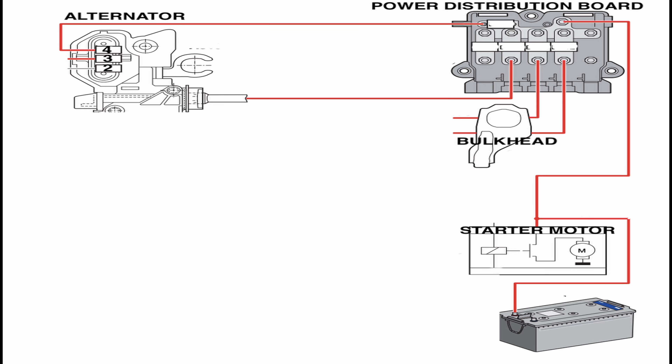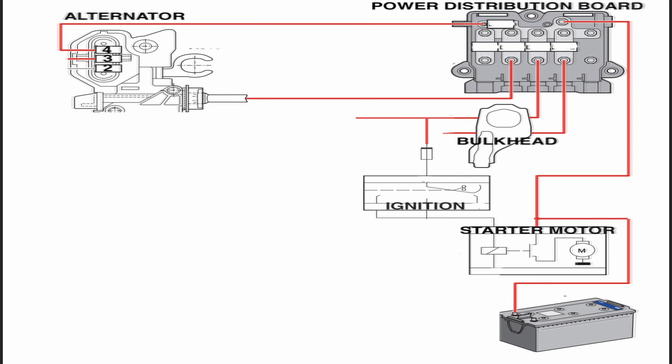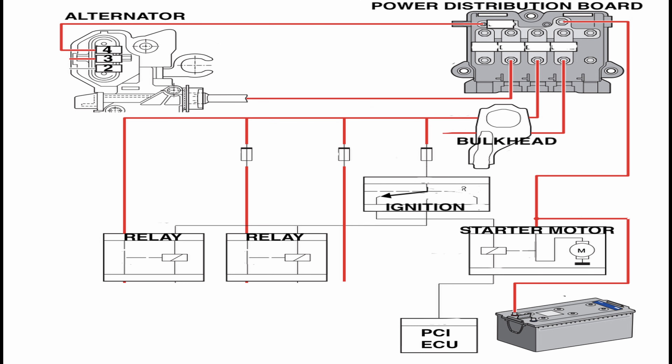The two power wires from the power distribution box are connected to the bulkhead and then to the central box, supplying the truck with power supply before contact. The ignition switch is supplied power from fuse E037, and when moved from the accessory position to ignition on, it allows current to flow to the ignition relays. Turning the key further supplies the starter motor solenoid to command the vehicle to start. Even with powers and grounds present at the starter motor, ultimately the PCI ECU has the last say, as it interrupts the low side of the starter motor solenoid and controls the condition to start the vehicle.